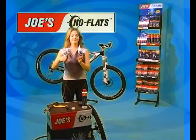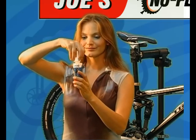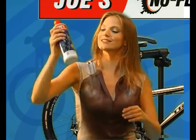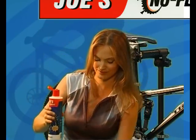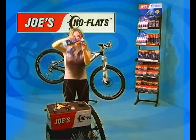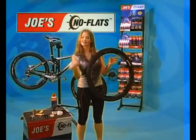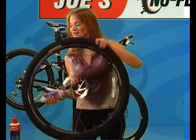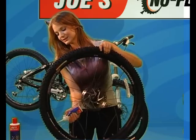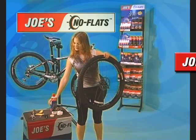When you are sure the tire will hold air, you are ready to add sealant. Cut the spout of the applicator bottle at a 45 degree angle, 4 to 5 millimeters below the top, and remove the cap. Shake the 500 milliliter bottle of Joe's Super Sealant and pour into the applicator bottle. Shake well and insert the bottle at the 12 o'clock position, then move the valve to 8 o'clock. Squeeze the desired amount into the valve, because the grains settle fast and will clog the valve and spout if inserted straight down. If the valve or spout is clogged with grains, use a nail or spoke to open the passageway.